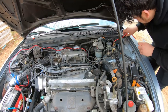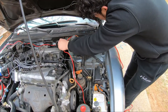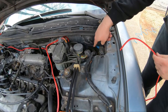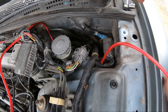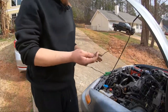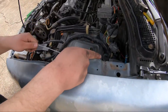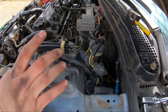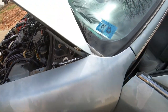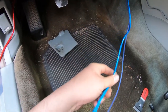Now I have to run this through the grommet. I'm probably going to need a second set of hands down inside — there's the grommet down in here, so I have to run this cable wire down through that little grommet to the inside of the car. The hard part is done — I literally had to grab a hanger, dismantle it, tape the wire to it with electrical tape, made the front of it so it wouldn't damage anything, and just poked it through that grommet. Now I got my wire ran all the way across.